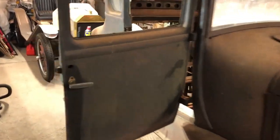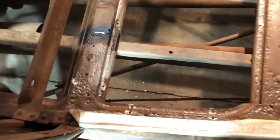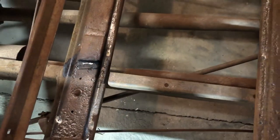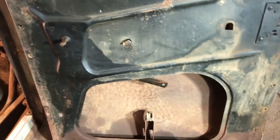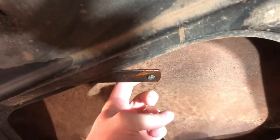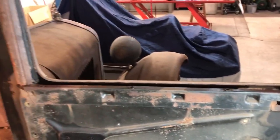I've made some progress on the 1926 Model T since last time. I've taken out these two floor pans — they're just riveted in. I took a grinder and a pin punch and punched out the rivets and ground the tops off. I'll be taking out the rear floor next. Over here at this door there was glass; part of it was broken but I had to get it loose. This little runner was broken, so since the glass was broken I was able to pull it out the top.